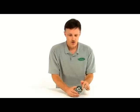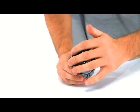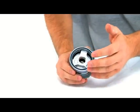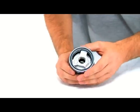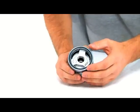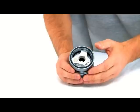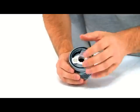Another feature: a square O-ring — it's not a round O-ring. Square O-rings resist blowout, so you're not going to blow this thing out as easily as you would with an oil filter that had a round O-ring. And another nice thing is they give you an extra one in the package, so if you damage this one, you don't have to worry about where you're going to get an O-ring.